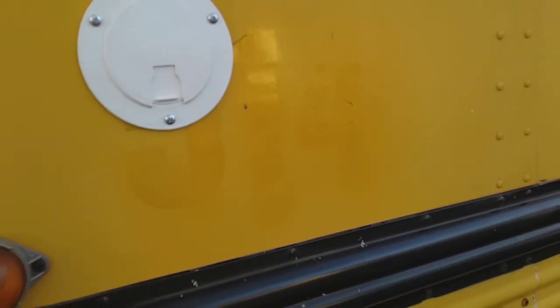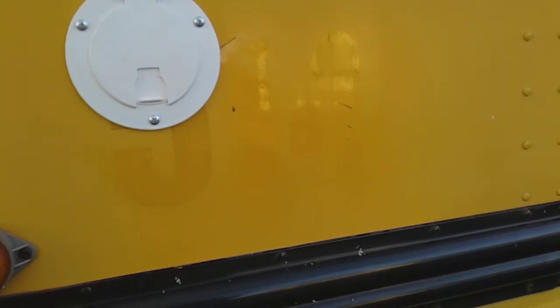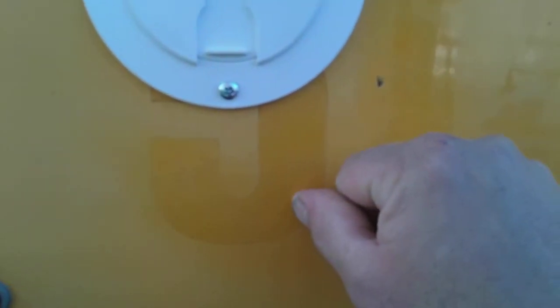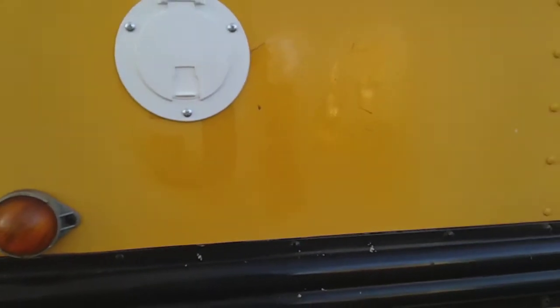You can see the number five is right where the hatch is, and the one and four is barely noticeable. I removed all the decals off the bus and it was not easy. I had to use a razor blade at first — as you can see there are a few scratches from that — and then there was sticky glue residue left over. I used mineral spirits on a rag and kept rubbing it, then scraped the glue off with my fingernail and rubbed it again with more mineral spirits. Keep going, keep going. It's a real tedious, time-consuming deal, but I got it done. That's what we got done on the outside.